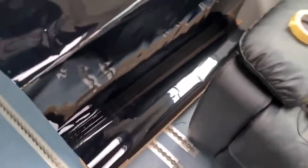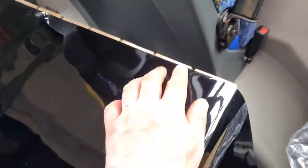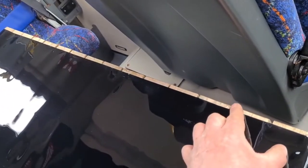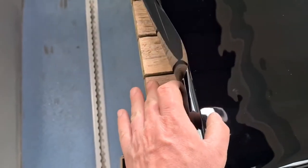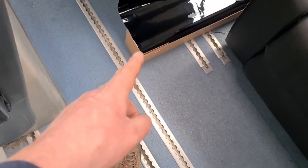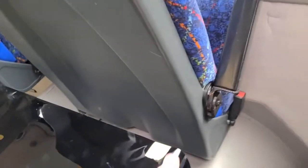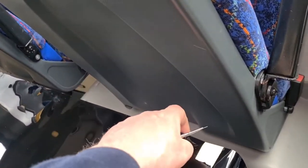What I find useful is to just lay it out on the table — I've got an old picnic table here. When I'm cutting it, basically get it roughly to length, measure it. Before I cut it, get it level — parallel, I should say — with the edge of the table, since you've got a square edge. Then put some masking tape and stick it on either end. When you cut your length, in my case I've got some slats in here, so I can cut it to length using this as a guide and get a nice square finish on the end. Keep the roll in the box as you're pulling it up — that keeps dirt off the floor and stops it rolling everywhere. You can see I've got it pinned down with masking tape at each end, and this edge is parallel to the table. I'm just going to run the craft knife across and cut it. And that should be that.